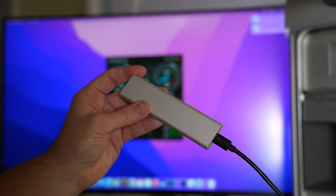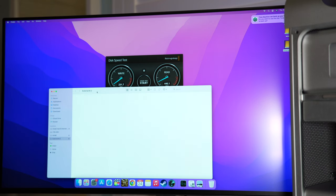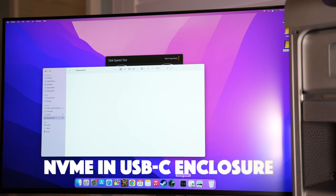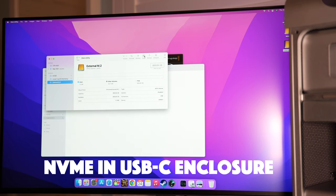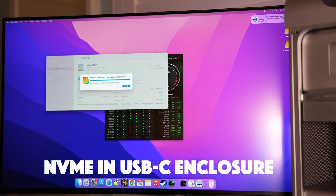This one I hadn't planned on using but was curious to test — it's basically an NVMe drive, a Sabrent Rocket, rated for around 2,500 megabytes per second in ideal conditions, inside a USB-C enclosure. This did really well — it performed pretty much the same as the NVMe I've got plugged in via the PCIe slot, with results almost identical at around 750 megabytes per second.